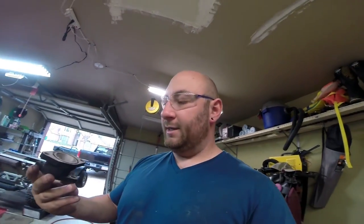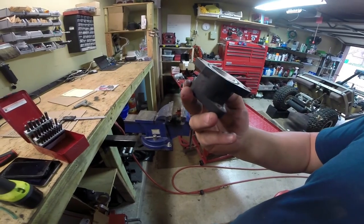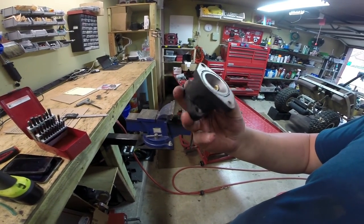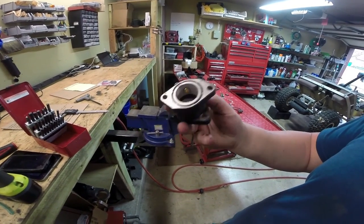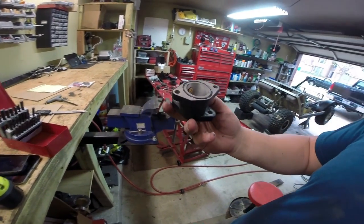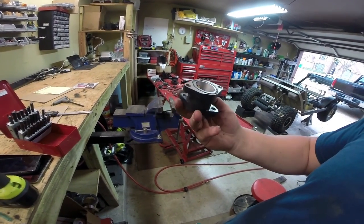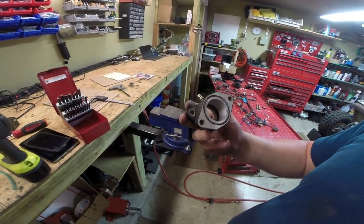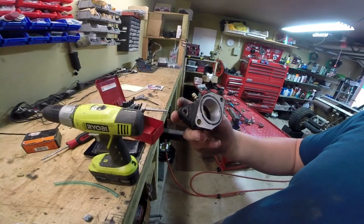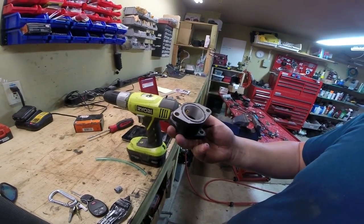After going slowly one drill bit size at a time, here's our final result. I covered it pretty good in silicone before pushing it through and had to use pliers to press it in — it's a nice tight fit. I added a little bit of silicone on the outside too. I don't think it's going to leak or have any vacuum issues, and there are still two barbs out here which is more than enough to run the vacuum pump. I'm going to let this cure and then put it back on the engine.